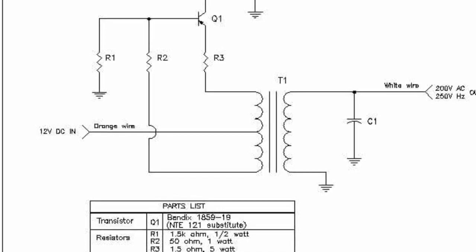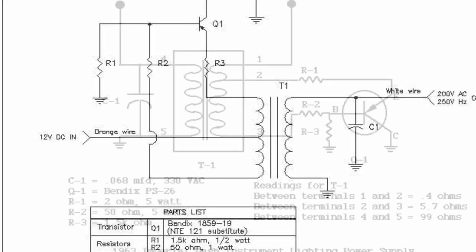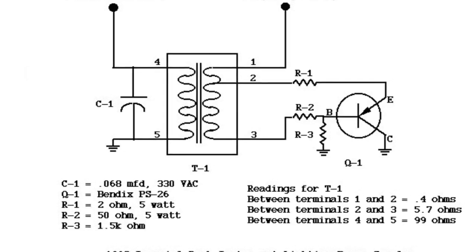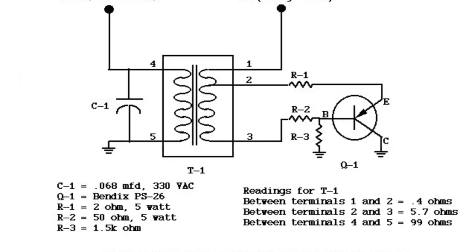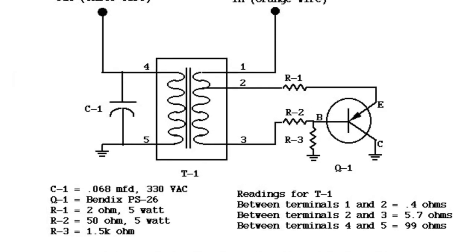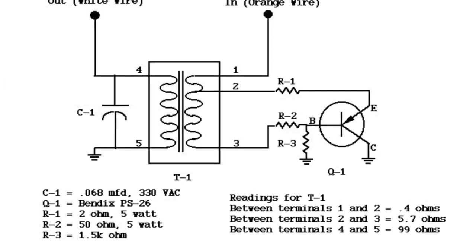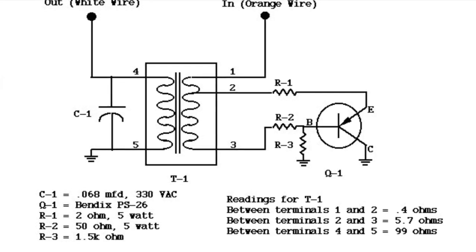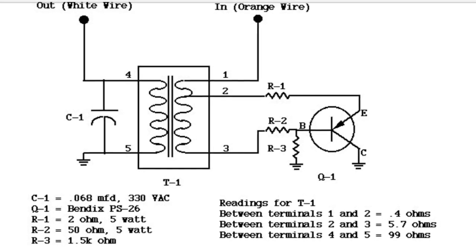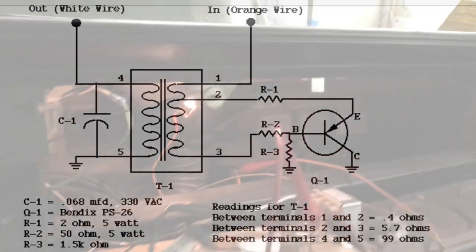I got the wrong transformer in the end because I had to guess on that — I could have spent more time figuring it out exactly but I didn't. In that first schematic I didn't get the exact transistor called out because it was like a $35 transistor, so I found a cheaper one. When I followed that schematic exactly it did not work. I then Google searched the transistor I did get and came up with a schematic for a '63 Imperial — I noticed some very distinct differences. I followed that diagram and was able to get a charge, but with the wrong transformer I'm still not getting the voltage I should be getting.